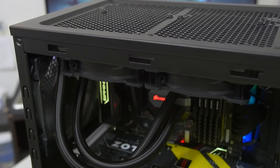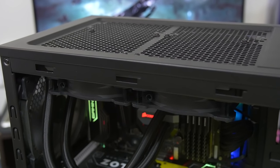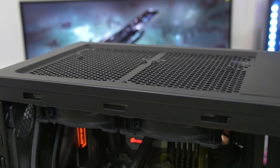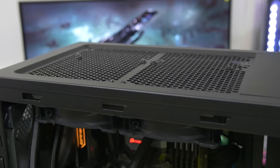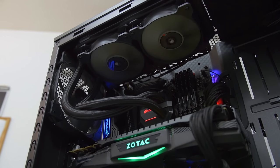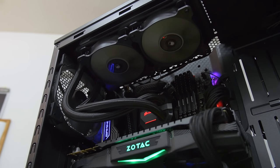There are pros and cons to both, and today we're actually going to test both options to see which one reigns supreme. The great thing about having your radiator mounted at the top as an exhaust is that you're exhausting all the hot air from within your case outside of it, which is good for your internal components. However, you're also permeating your fin stack with that hot air, which could potentially be hazardous for your CPU temps when your GPU is generating lots of heat under load, and that warm air gets circulated inside your case and passed through that fin array.